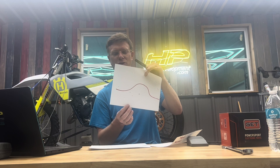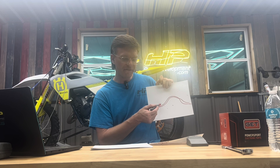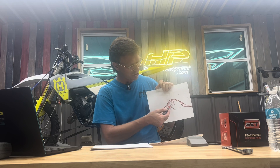So how does your carburetor work? When air moves across that little hole, if it's moving at anything faster than zero, it decreases the pressure around it. The pressure inside is less than the pressure outside of the tube. Anytime you have less pressure inside than outside — which is what the vent tube does — fuel will come out. It's like the atmosphere acting on your float bowl and pushing the fuel out. That's how carburetors work. Air already moving into our engine allows us to have carburetion — a really cool idea. If we have a pressure wave, that's what your needle is seeing. Air starts moving, picks up velocity, drops off, stops moving — and the carburetor supplies fuel exactly like that. You change the jet size and that changes how much comes out.